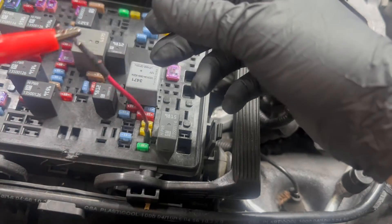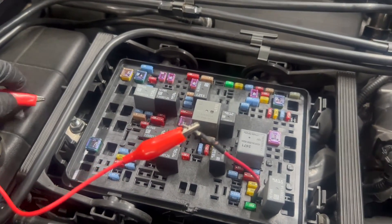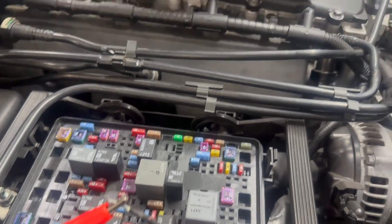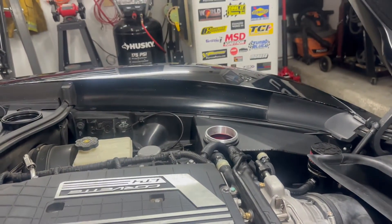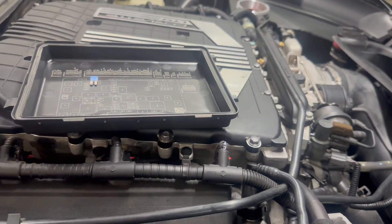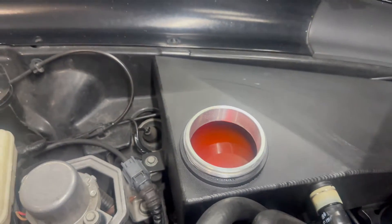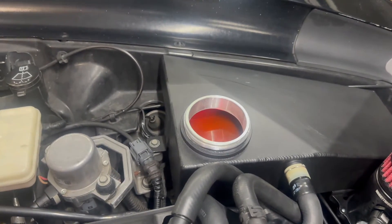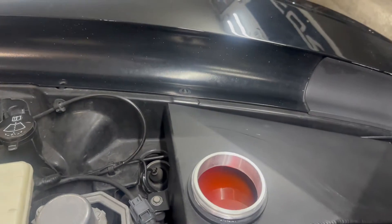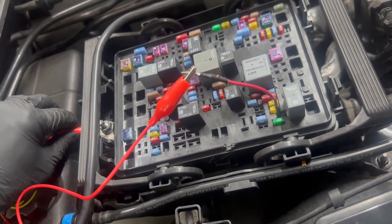Easy enough — just take your male terminal, stick it into that left side, connect it to your lead, and then simply connect it to positive power, which I have here from the battery terminal going into the car. Right now the tank shows no coolant flowing through it, so just to show you what happens when this comes on — there's nothing flowing right now. I also have that extra tank on there; otherwise you can just listen and feel the hoses for it bleeding out, or have the funnel sticking out from the bleeder.